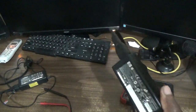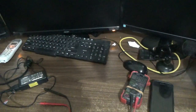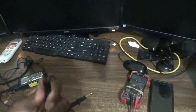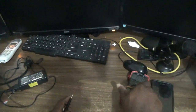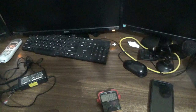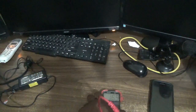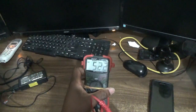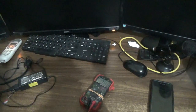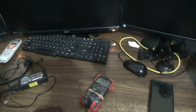This is the HP charger. I've realized that I'm basically not getting any current — I would have already tested it. You have to ensure that you have a voltmeter to actually test it. I'm supposed to get 19.7 volts, and as you can see I'm getting nothing.